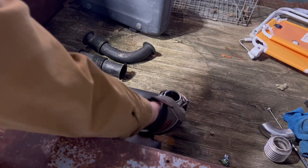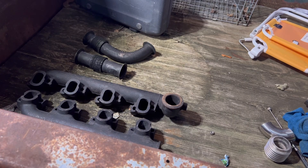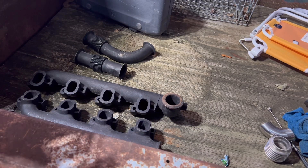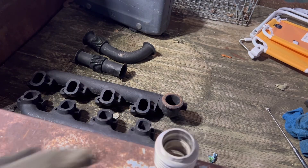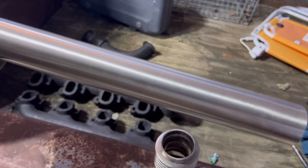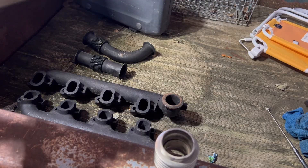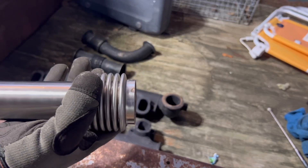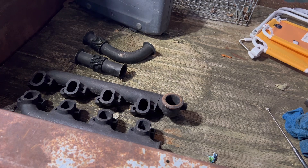Our next hurdle is going to be the fact that I was playing around with these trying to make them fit to see if I could get them going on the manifolds — they don't, if anybody was wondering. So our next part to this is I have to make sure these are going to go together. I've got elbows here. I have straight pipe as well. Purposely bought slip couplings so we can basically make the up pipe as long as we need to. I do not have a TIG welder — this will be all MIG, because that's what I got. Here's the bellows at the top. Obviously you don't need them this long — these are the shortest sticks I could buy.